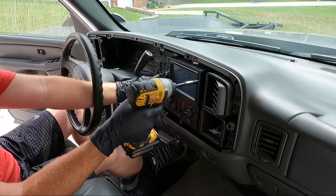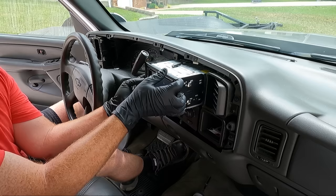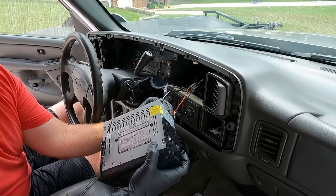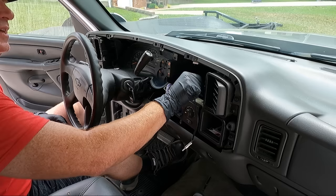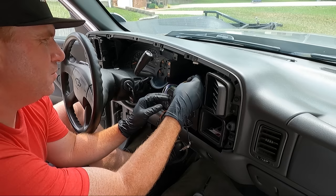What I'm really hoping is our new radio will fit in this housing because I do not have one — that may delay this video if it doesn't. Once we get that loose, we can see our mess of wires. You are going to need an adapter. Obviously this radio has one, so I'm going to be keeping that. Look at what we've got here — they've got wire nuts on it. If you're hooking up stereo, let's not use wire nuts. Let's use heat shrink or black tape and solder. That's the way it should be done.